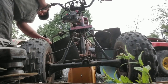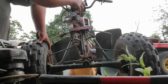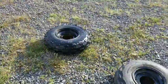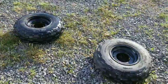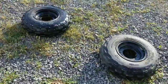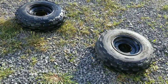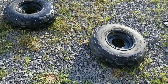All right, so now what we have is this — they're out. I aired up the tires to 36 psi max, set the bead, soaked it in water, and the tires seem to hold air except around the bead. I don't know if it's the bead on the tires or the rims — I'm pretty sure it's the rims, because I discovered something really bad with these rims.